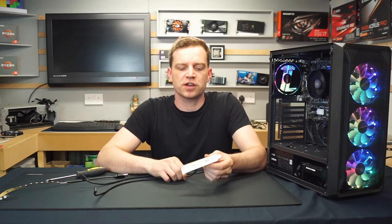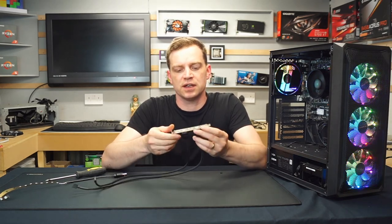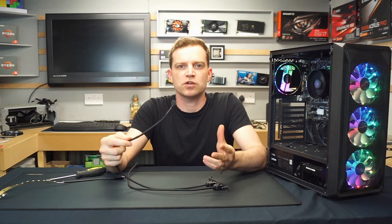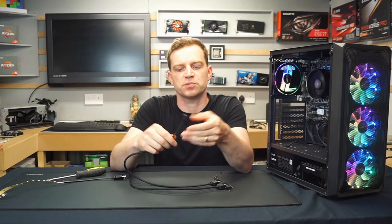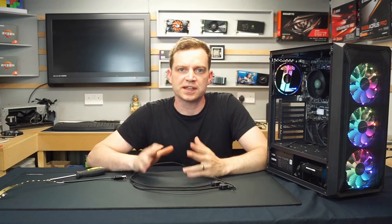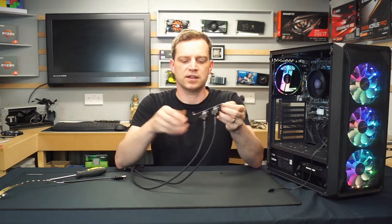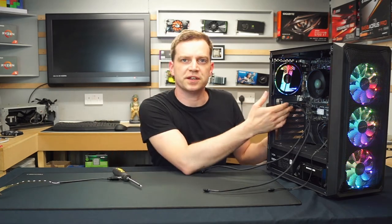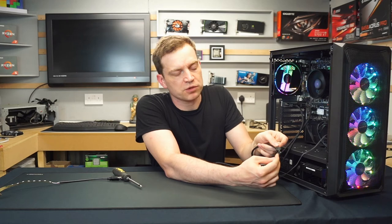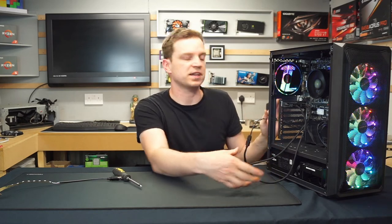We've finished making both cables — two panel mounts, now braided with RGB ends on one side and USB on the other, mounted onto a PCI card. This card simply goes into the machine, screws in, and lets you connect to either the motherboard via RGB or ARGB using the four-pin connectors. With the machine out and the PCIe card installed, we can plug it into the controller adapter, lining up the two arrows on the connectors, and the RGB signal should now be sent out to the rear USB.